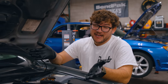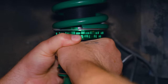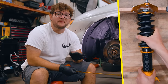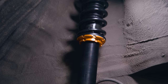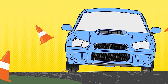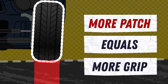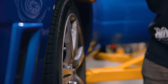When it comes to adjustability, both teams are actually pretty even — we've got four settings we can tweak: ride height, preload, camber, and damping. Adjusting ride height by threading the lower mount up or down allows us to raise or lower the car and adjust our center of gravity. Adjusting preload changes how much compression you apply to your coil before it's under any load — it's really just meant to keep your springs properly in place, and 90% of the time you should follow whatever the manufacturer recommends. Adjusting camber lets us tilt the wheel in and out to change how it rides on the ground. When you take a corner, all the weight shifts to the outside tires and the body rolls. You want the biggest contact patch available so you have the most grip to fly through the corner, and the included camber plates let us adjust that.